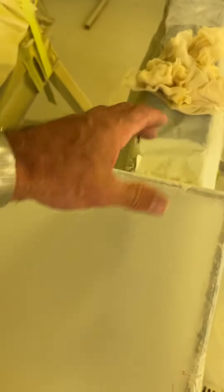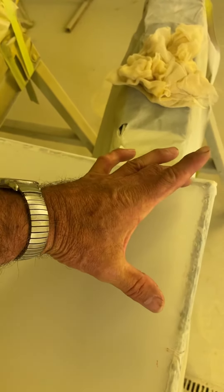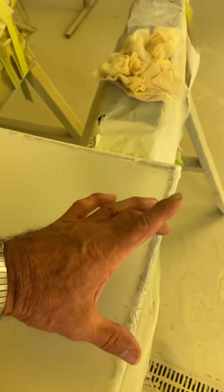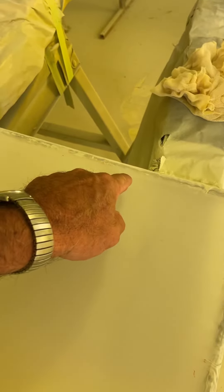So you're going to have to somehow time it out to get that extra coverage at the top — you might even have to be blowing past it. I always blow 90 degrees into the edge and then come across. So if you just come in and go there, and then go there, working your way down, you only had one pass and you could have pin holes and you wouldn't get the flow into them.